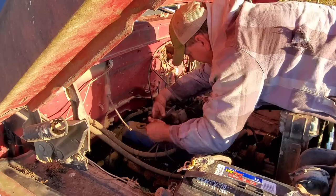That's it right there. Long story short, this carburetor wants a higher float level than it should. I don't know why, but it does. Went to adjusting on the carburetor, and it got to missing, the motor just shaking. And you're not going to adjust the carburetor unless it's hitting on all cylinders. So I decided let's put some plugs and wires on it. Of course, the store didn't have them, so I had to order them.